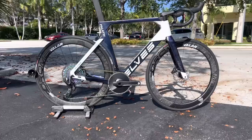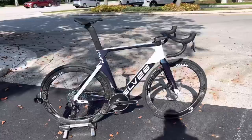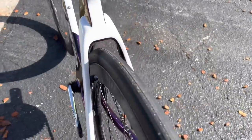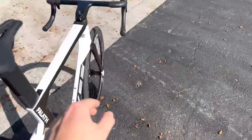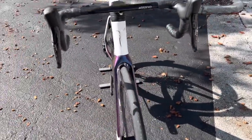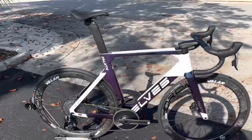The bike is fitted with a Vittoria Corsa Next tire — it is a 700 by 30c tire. This bike can take up to a 32c, so we're really seeing the boundaries here, and as you can see it fits no problem. The wheel internal width on these new wheels is a 22 millimeter internal width, so the 30s fit perfectly up front — you can see there's a ton of clearance, no issues at all.